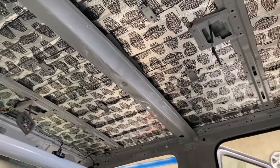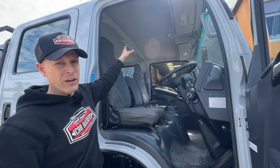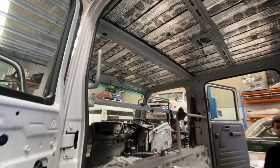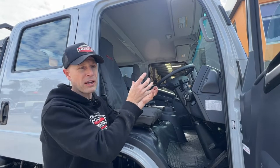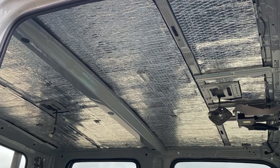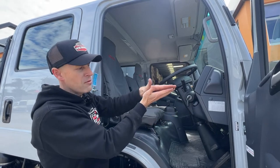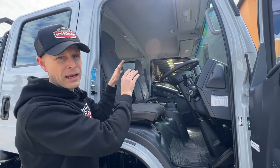Then we've got your van liner. You've got a bit of room up there, and the reason we've used van liner is we can fit twice the amount of material. There's a bit of jute padding on this particular truck stuck to the headliner sheets. When you pull it out, you'll see them — you're going to need to remove those because they won't fit back in. Now, the roof is going to reach mid-80s degrees Celsius in peak summer. So although it's self-adhesive, I like to add spray contact adhesive on the back of the foam and also on the sound deadener face. Put your van liner up, use a roller, roll it out so you've compressed the foam and the glue holds it. Then it'll last for the lifetime of the vehicle. Once it's all back in, you can put your headliner pieces back up, seal it up — that's done.